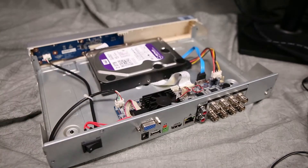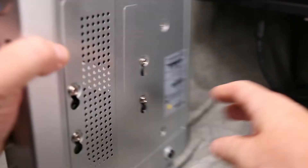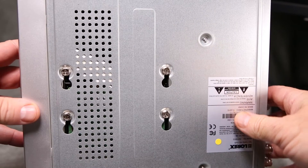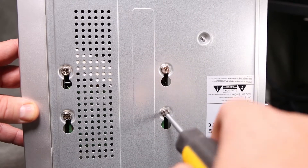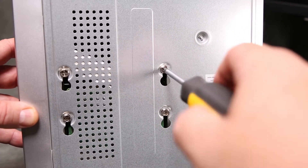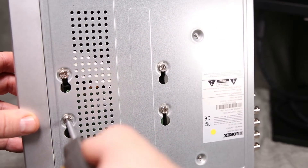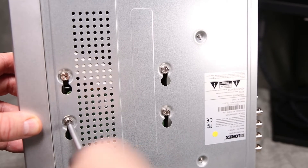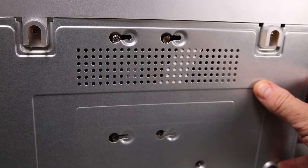We can see the 2TB drive attached to the frame. We can gently tilt the chassis up on its back, making sure not to damage the connectors at the back. There are four screws that hold the drive in place. Simply loosen the screws with a Phillips head screwdriver. Once the screws are mostly untightened but not completely removed, you may gently slide the drive so that the screws slide along the slot to the larger hole.